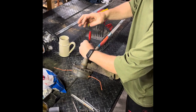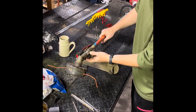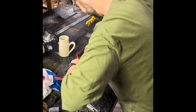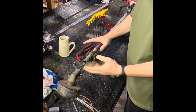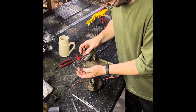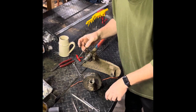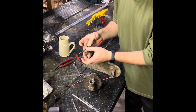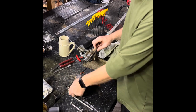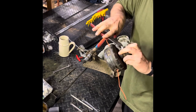Just back the screws off. I'm going to slide that back and wiggle this off. You can see how tight this one is — it's basically brand new, barely been used. If you're looking at the difference between a 272 and a 242, here's one of them: the shaft is larger on the 272. These splines getting stripped or breaking usually strip the clutch, and it was because everything was loose with slack in it. If everything's tight, it doesn't have that momentum to work like a hammer.